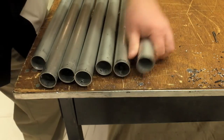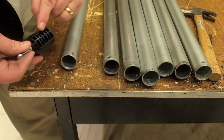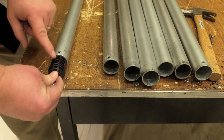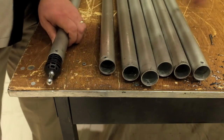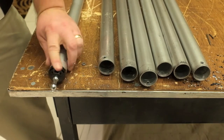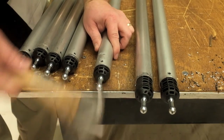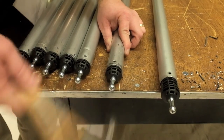Now to line up our ball caps with the existing hole. The small ball cap has three rows of cavities — you want to line up the center row of the cavities with the existing hole in the crossbar. Just press it in; you can use a lot of force here, these composite ball caps are very tough. Tap it in until it's fully seated, and as long as that center row of cavities is lined up with the existing rivet hole that you drilled out, you'll be in good shape.